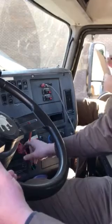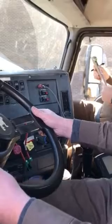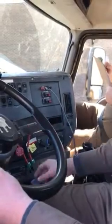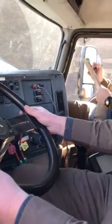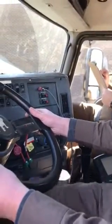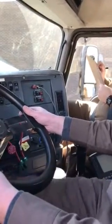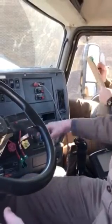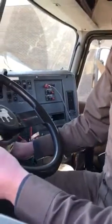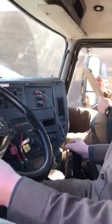The trailer air supply popped out at 90 because we don't have any back pressure from a trailer. I'm going to continue to fan the brakes. At 50 psi, the audible buzzer and visual light on dash warnings were activated. At 30 psi, the tractor park brake engaged, which I'm verifying by pulling on the valve. Tractor park brake applied. Transmission in neutral — depress clutch, cover the brake. I'm going to restart the engine. Oil pressure is rising: 10, 20, 30. End of the low air warning test.